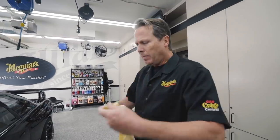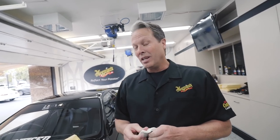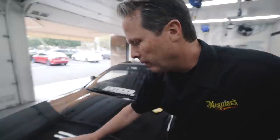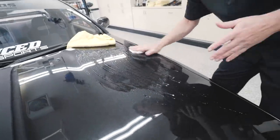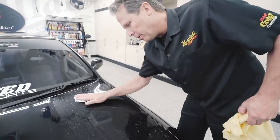Claying is really easy. A lot of times we hear that claying can take a long time and it's really hard to do, but it really isn't. No matter what brand you use, you got a lubricant, you got a clay, and you literally come in here, get all the loose contaminants off, and that's what we did by wiping. Then you lay down a little bit of a lubrication layer and just take that clay and start working that paint. Now, you don't need to push hard, but what's interesting, the more you do this, and if we flip this clay over, depending on what's on there, you can actually see. That looks like a lot of black overspray from something. Could have been sitting in a shop somewhere, somebody else painting, doing brake work, whatever.